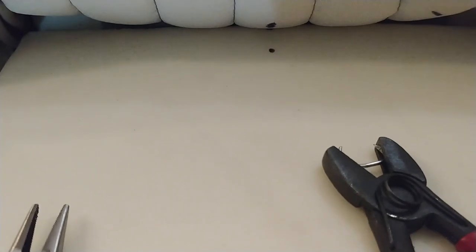But I'm just going to go down the line and ring this thing up and get everything as tight as I can. Another thing I'm doing is, you can see those marks that I've got there. I've tried to center the upholstery on the foam as best I could and make sure that I get these, I don't know if you can see that, hog ringed onto the rods that go through the foam.